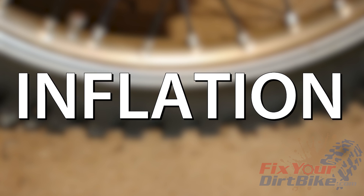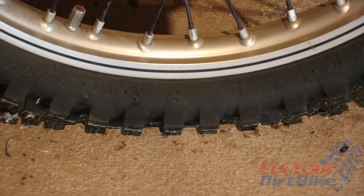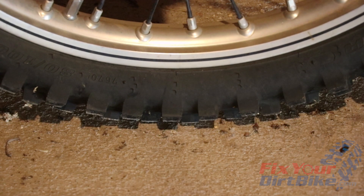Keep your tires inflated. Proper inflation keeps your tires in the correct shape. When your sidewall is collapsed, all the weight of your bike is sitting on that bulge in the sidewall. When your tire is inflated to spec, it will distribute the weight evenly.